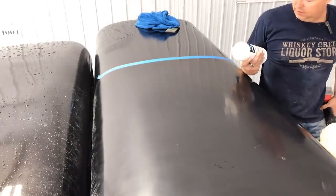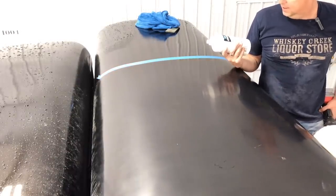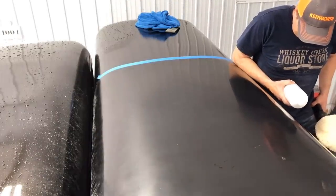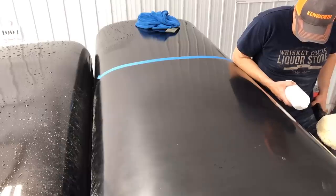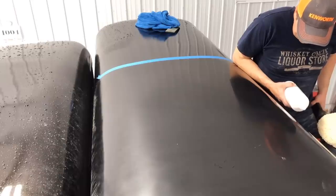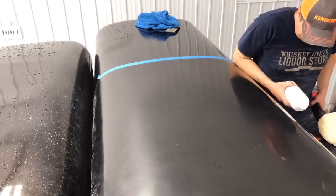What I got here is called a Liquid Ice Extra Cut Advanced Polishing System. It's designed to be the more aggressive polish as needed. The product will remove sanding scratches 1200 and finer, swirl marks, haze, or oxidation on fresh or cured automotive paint. Put your buffer between 1,000 and 1,500, apply medium pressure, use a wool pad.